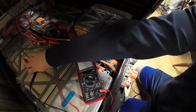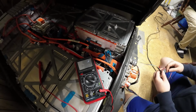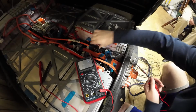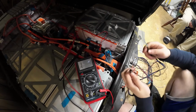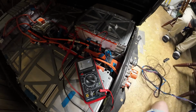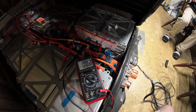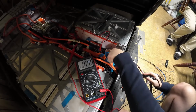Okay, good. So that means now that if we grab our harness, plug that in, we have the color code diagram. These should be our contactors. Put that onto there, hide it in sheathing. Now, when I apply ground and 12 volts to one of these, that should click that first one. So that's that contactor. Yellow, positive contactor. So that's the right post, that first incoming.